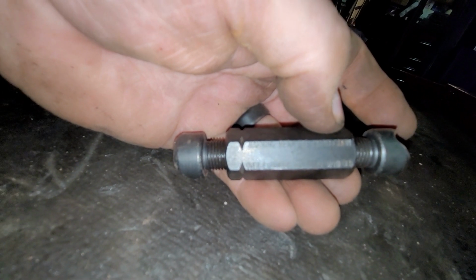I did see one one day on like a hang package in the parts store, which I thought was kind of neat, because this is not something you see every day. And it's cheap. When I bought this thing, it was probably 10 bucks. It's probably 25 now. But even still, if you're using your old exhaust manifolds, you want to have something like that. Many of the older American cars, big block Chevys, Chrysler, Ford, AMC, they all used a manifold design similar to this, with independent legs that weren't tied to one another with a casting. So it can happen to any of them.